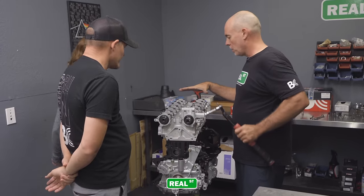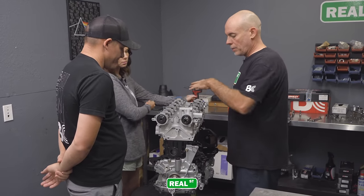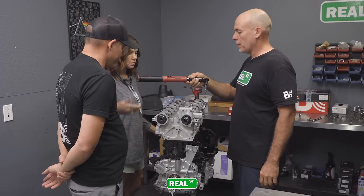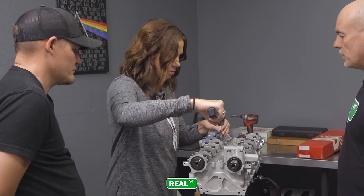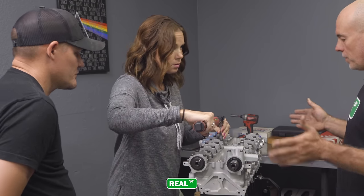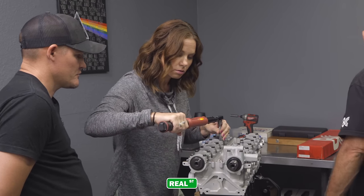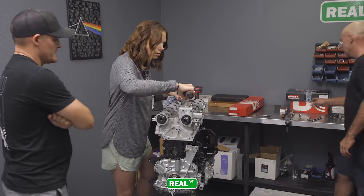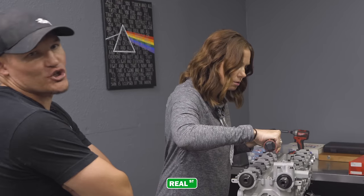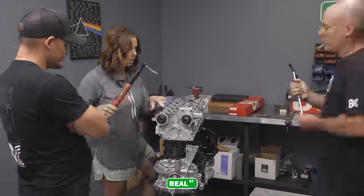So you need to do all of these bolts that have the 10 millimeter head to 14 foot pounds. Boom. And then this across from it? You have to do each cap and then move out. Center out, okay. Yeah. Boom. Watch your face. I think that was a song in the very first Fast and Furious movie.